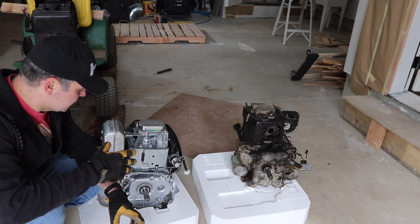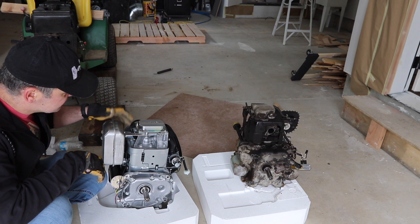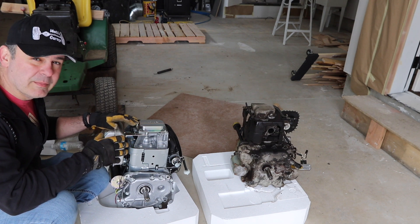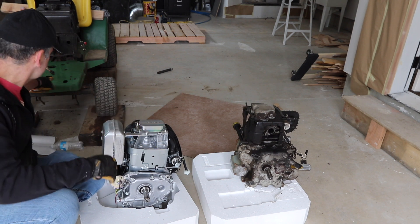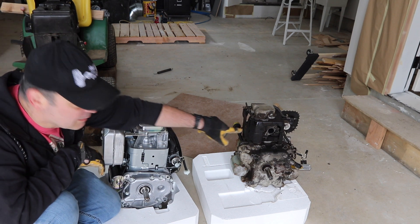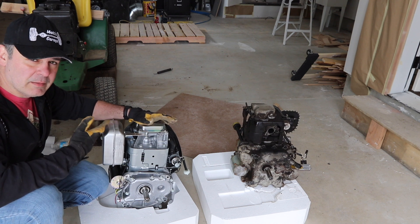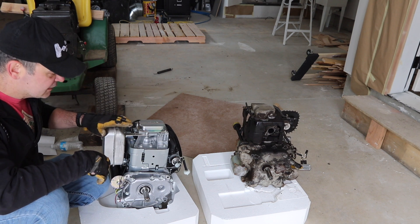I almost forgot to mention this. The model I bought was the cheapest 17-horsepower Briggs & Stratton, and it's got a side-dump exhaust — this is the muffler. If you've got an STX 38 with a hood, this will not clear. They make another one that has a tube that comes around and down through the hole where the original John Deere exhaust — which is a bottom-dump exhaust — goes through, and you can reuse it, and it actually comes with a muffler. I've never had a hood on this; it was given to me by a subscriber, and I don't care for a hood, so I did the side-dump exhaust.